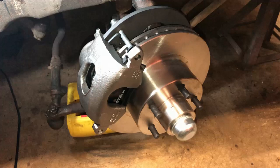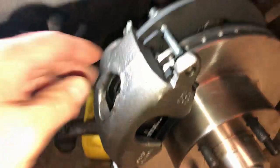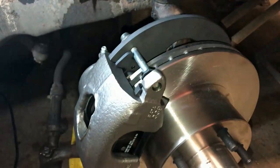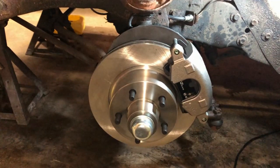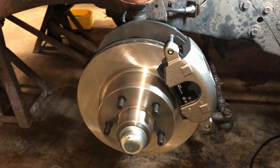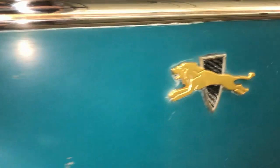The passenger side is as far as I can go for now — the brake hoses were back-ordered so I'll get them the next day. But I've got the rotors and bearings all packed, dust cover on, caliper on, and ceramic pads on there. The bolts are all lubed up so everything slides good — never-seize on the threads. The job's completed — fluid in the lines, brakes bled, all hoses on. Everything went together real easy, just a matter of buying the parts and bolting them together. Big thank you to AAJ Brakes — they made it really easy.